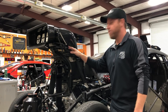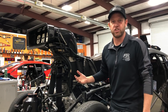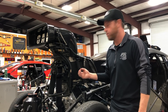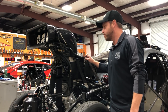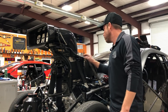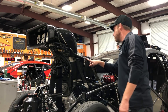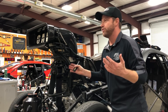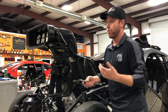We leave the barrel valve and go to one of the most important components of the mechanical fuel injection system: the fuel flow meter. This is hooked to the data acquisition system in the car. We monitor this channel at 100 frames a second, and it measures how many gallons per minute of fuel the engine is consuming. Fuel leaves the barrel valve, and from here on it's pretty wide open to the crew chief on how this is plumbed — there's no right way or wrong way.